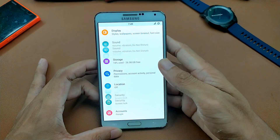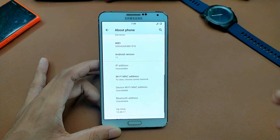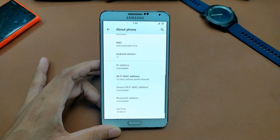This ROM is specifically for the SM-N900 — I will put TWRP and everything in the description. Installing the ROM is pretty simple: you don't need to unlock the bootloader or anything. Just flash TWRP with Odin, but be mindful to uncheck the auto-reboot feature in Odin. If the device reboots directly to the OS, TWRP won't be installed. Instead, manually boot into TWRP by pressing the Home, Power, and Volume Up buttons together from download mode.